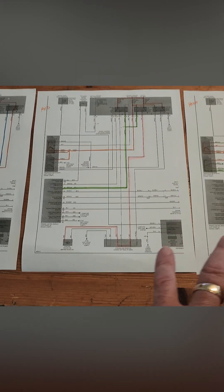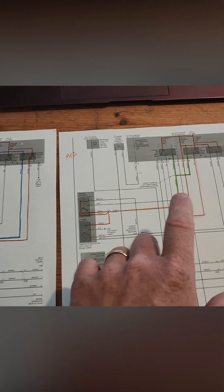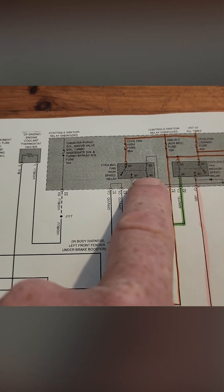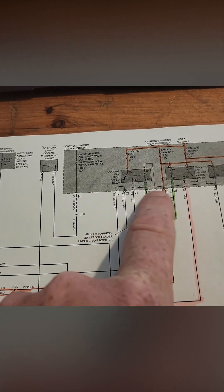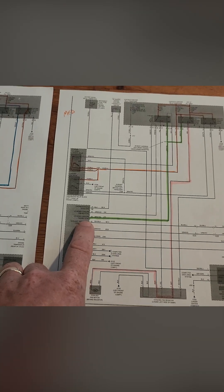Get a diagram in front of you, highlight the circuits — powers and grounds. Remember your fundamentals as far as relay coils go: they need power and ground to make a magnetic field. Never draw through them with the same color, because that helps you dissect the circuit.